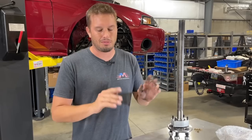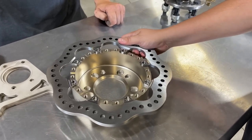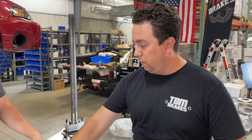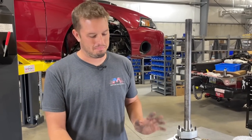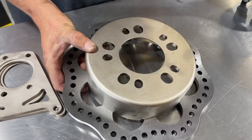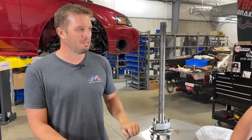You end up spacing stuff with washers — that's never a good idea. So you can either guesstimate what it needs to be, or if you take your axle offset and subtract half the thickness of the rotor and half the thickness of the caliper, that gives you the exact depth you need. You just measure and find out what that depth is, and you're calling it without even mocking it up. We determined it's going flat side down on the bottom step. The other cool thing about these hats is they're actually slotted, which makes them able to be used with four and a half or four and three quarter inch axles, half inch or five eighths. So the same hat works for all those different patterns. And coming soon they'll also have five-on-five as well, so you'll be able to tackle the real big stuff.